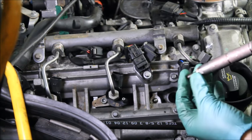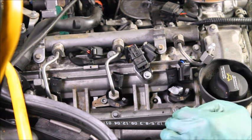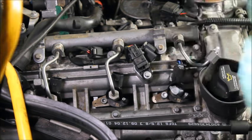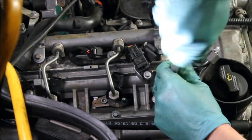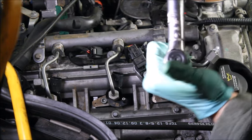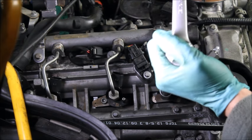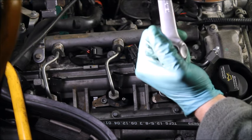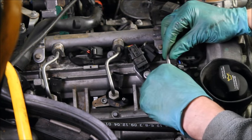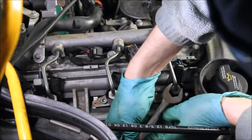Go ahead and put the new copper washer onto the end of the injector and lower it down into the injector hole. Put the clamp back into place and screw the new bolt in just finger-tight at this stage. Set your torque wrench to 8 Nm and tighten up the bolt slowly until it clicks — I always check it twice. Next, using a ratchet, tighten the bolt a further 2 times 90 degrees. Now all you have to do is reconnect the diesel fuel lines and the electrical connector, and then put all the other stuff back on top of the engine — the inlet pipe, the air boxes, etc.